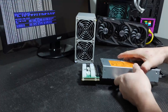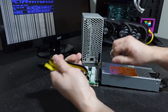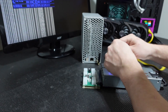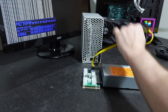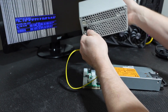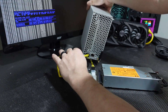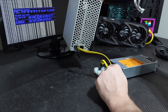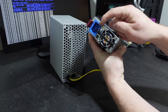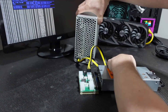What I'm going to do is I picked up a 750-watt HP power supply with a breakout board. It has the six-pin, and on the back of our miner we have our six-pin there. I grabbed a PCI cable — this will allow you to do multiple miners, so over time I'll buy more and plug right into the breakout board. These are six-plus-two, so we pop off the two, and there's six — we plug into our miner and we're set up. Power comes from the HP server power supply, and on the back it has a typical plug just like your computer, running from there to the wall outlet.